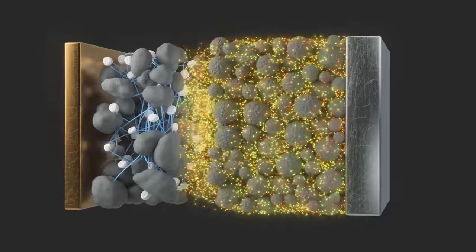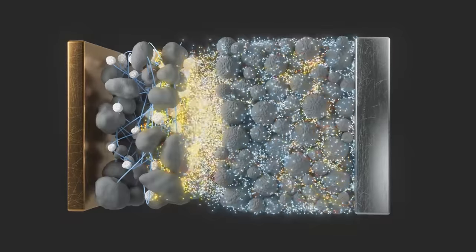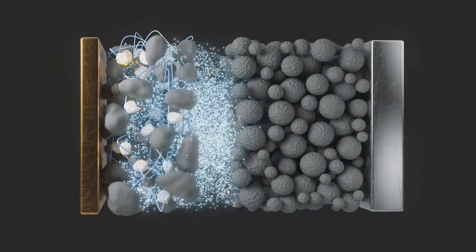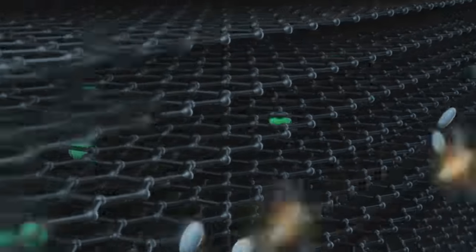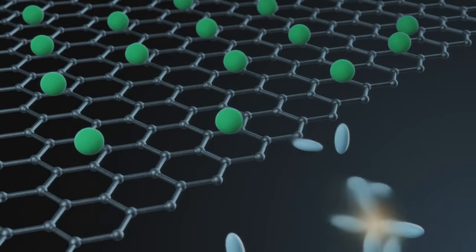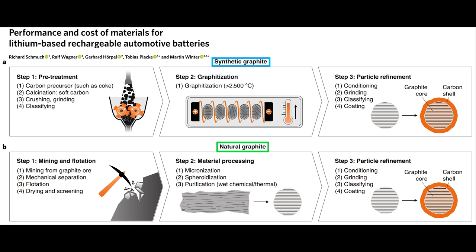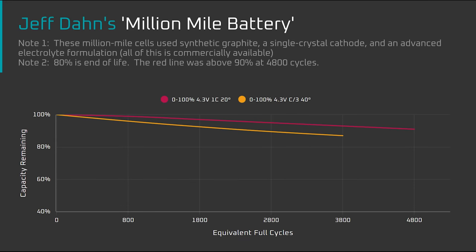There's no free lunch with batteries — there's always a trade-off, and it's rare to find a significant improvement to lithium-ion batteries that doesn't also come with drawbacks. High silicon anodes can dramatically improve energy density and charge speed, but they also nerf cycle life. The humble graphite anode is often looked down on as old technology, but it's really quite a miracle. It has about double the lithium capacity of most common cathode materials, meaning it's actually the cathode that's the true limiting factor in the battery cell. It has an excellent voltage potential that's near zero, it's relatively inexpensive, and in terms of scalability, graphite can be found naturally in geologic formations or manufactured with a synthetic process. As Jeff Dahn's research has shown, a high-quality synthetic pure graphite battery cell with the right electrolyte and cathode is exceedingly stable, with a potential service life of millions of miles in a vehicle or decades when cycled daily in grid storage.